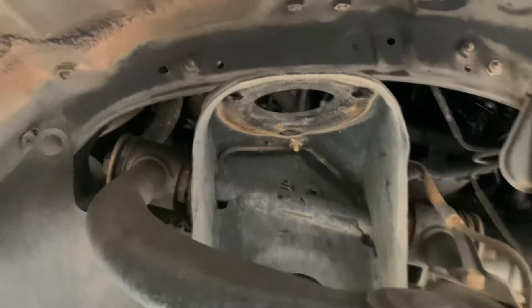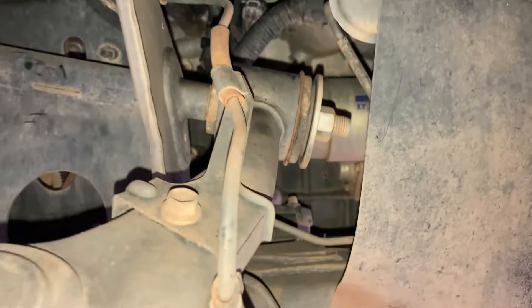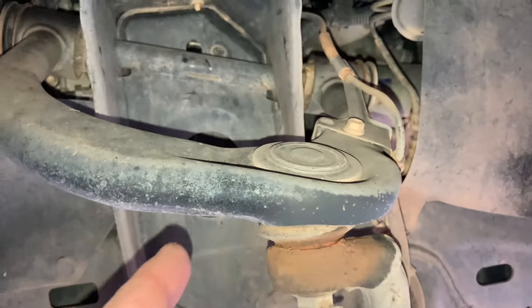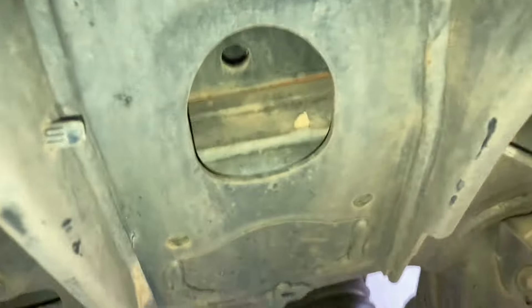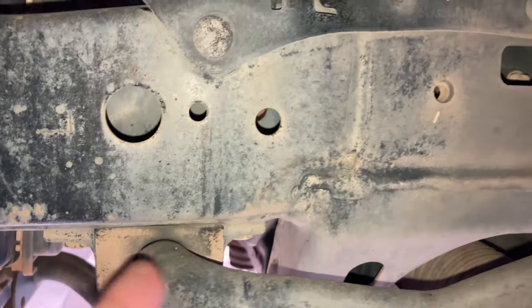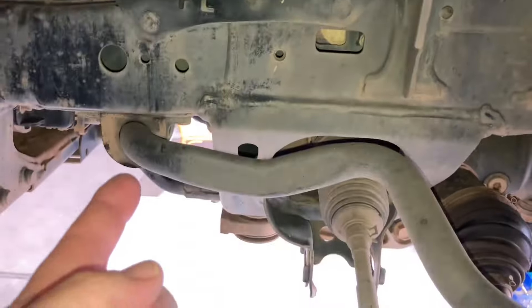Since this video is probably getting a bit long, you can inspect and clean that if you like. Some people have these nuts come loose — check those every now and then. I've never seen one come loose except when people have worked on the vehicle, so double check those. You can hold the bolt at one end and tighten the nut at the other. The sway bar hasn't even been loosened — it's in position. It's a bit tight getting the strut through there, so you've got to wiggle a bit. If you're putting in new suspension, the sway bar position might make it tighter or looser. It's not hard to take the sway bar off once you've got the bash plates off — a couple more brackets and Bob's your uncle.